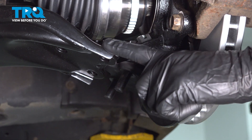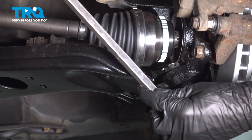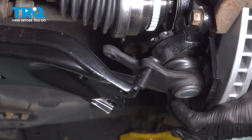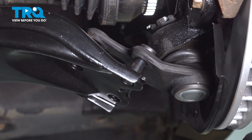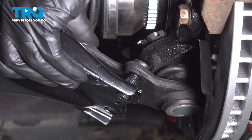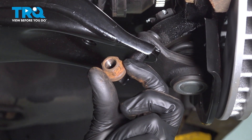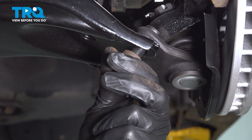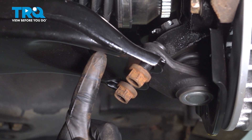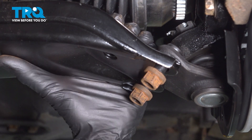Now it's time to attach the lower ball joint to the lower control arm. Flex that control arm down — if you need to, you could use a pry bar. Continue on to aligning everything; you're going to have to push the axle into that wheel bearing a little bit. Along the bottom, we'll continue on with our hardware. For the mounting bolt itself, you may have to carefully squeeze the ball joint and control arm together — make sure we do not cross-thread this.